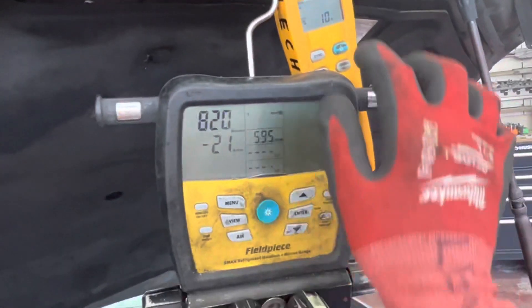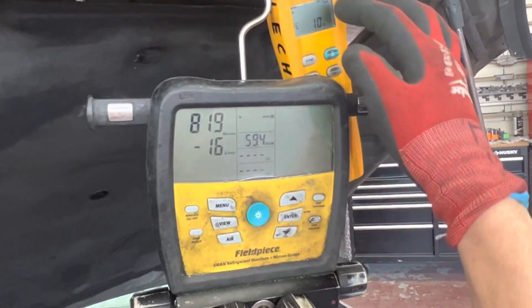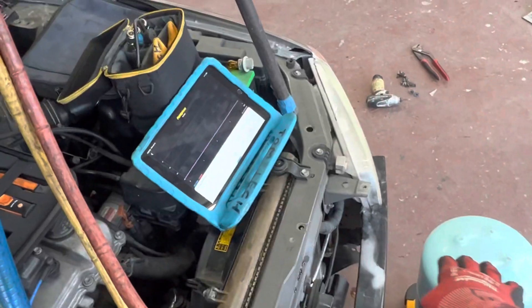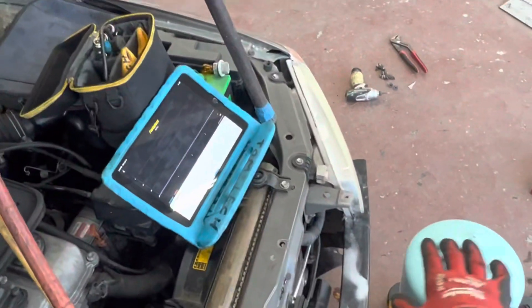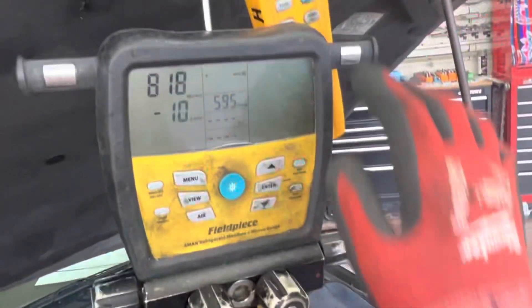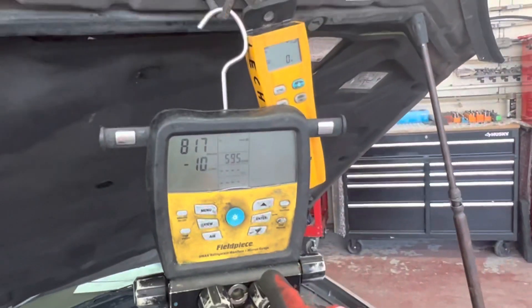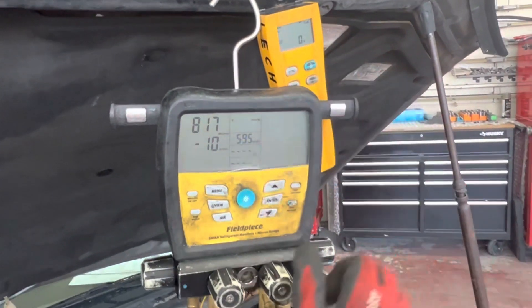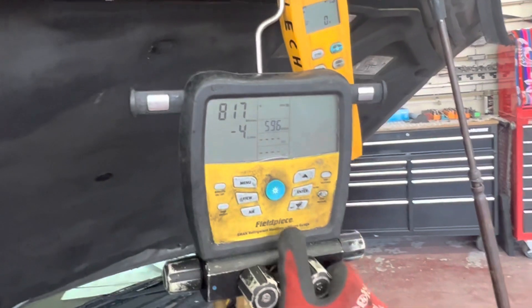Let's see if we can all see it all in one. There's the grams right there. The scale is moving a little bit within 10 grams, going back and forth — there's a little swash of the refrigerant inside there. We're going to see the pressures here, see me open it right here, see the grams right there. Count how many seconds it takes to get 850 grams in.